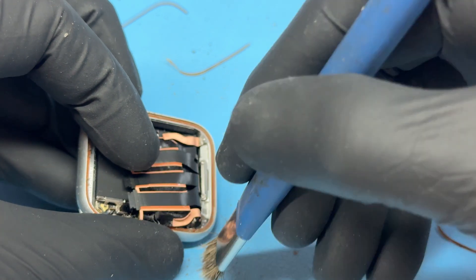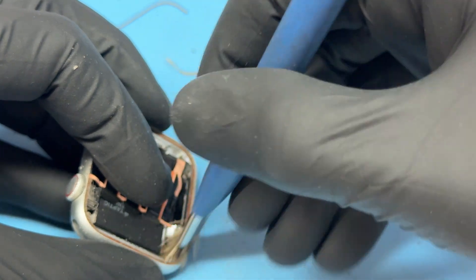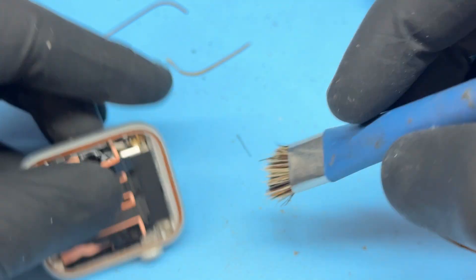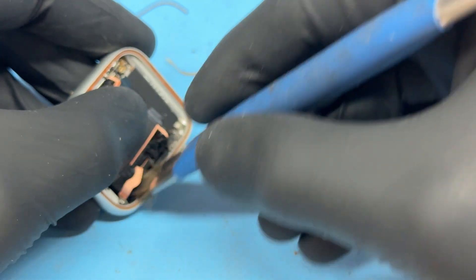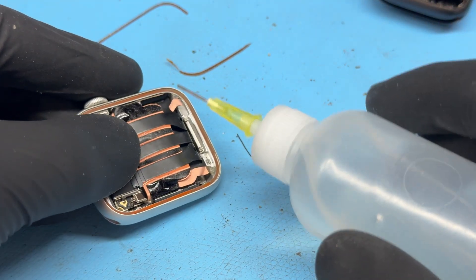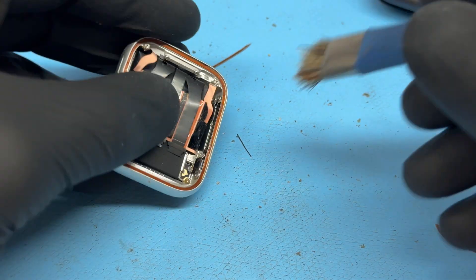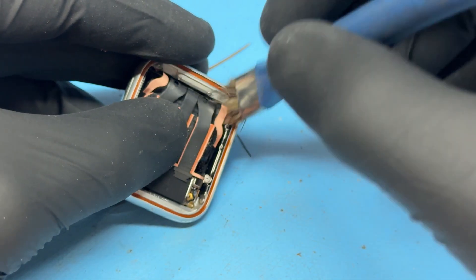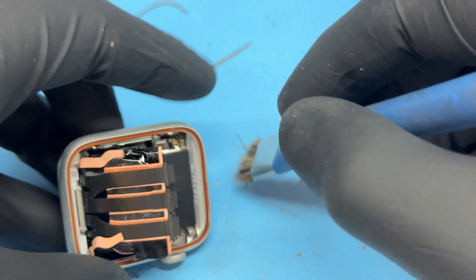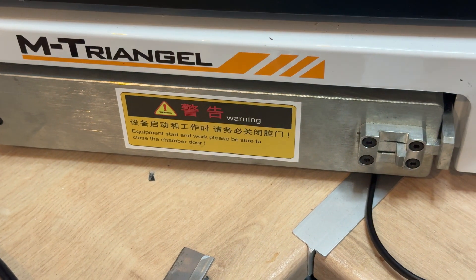Make sure it's really clean and all scraped out — you don't want that dust in between your seal, you really don't. Once that's done we're going to do the brushing trick — these brushes are really good; I'll try to put a link in the description below for most of the tools I use in this video. Once the heavy dirt is removed we can get some isopropyl alcohol in the little dripper bottle, apply that around all the edges, and then give it another brush to make sure it's really clean and spotless. Can't stress how important this step is. Now that that's clean, we'll let all the alcohol dry whilst we remove the screen from the pressure chamber.